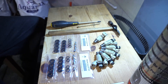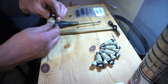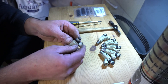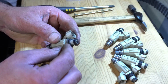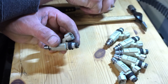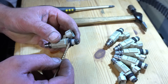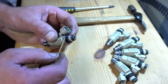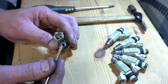The basic principle is you want to strip down the old injectors first, then once they're stripped down we can clean them out. This is the old injector — I've actually taken a filter out of that one already. In here there's no seal on the bottom, that's in the intake manifold already. This seal here is like a rubber buffer that spaces out the fuel rail, held in by the o-ring. The o-ring is what seals the injector in the rail, and this is more like a rubber spacer. These are very perished on these injectors — they don't do a lot, but it'd be good to get shot of them.